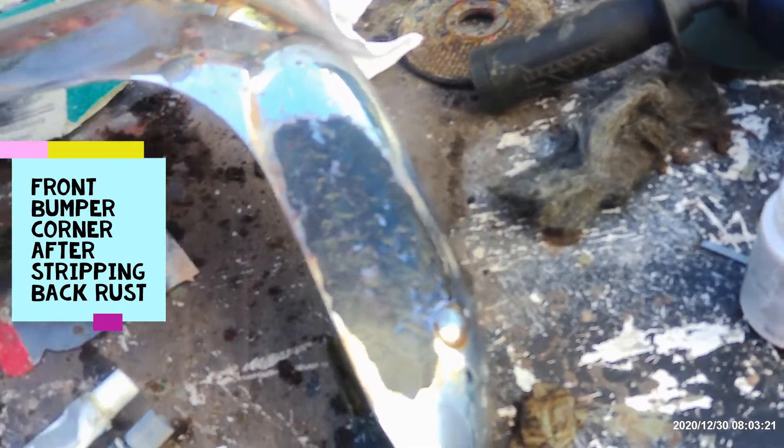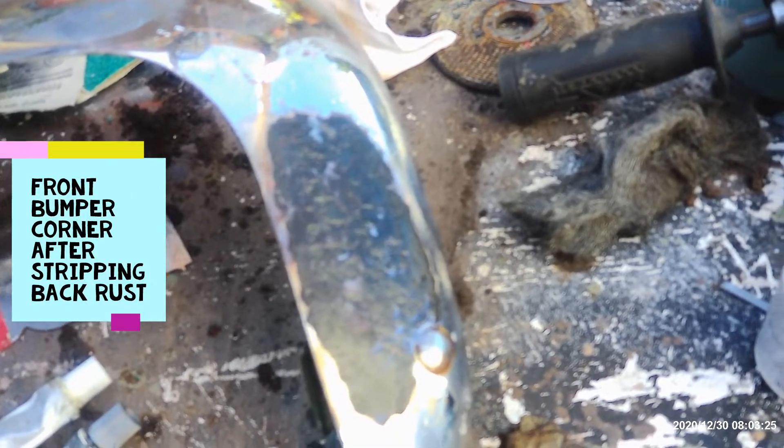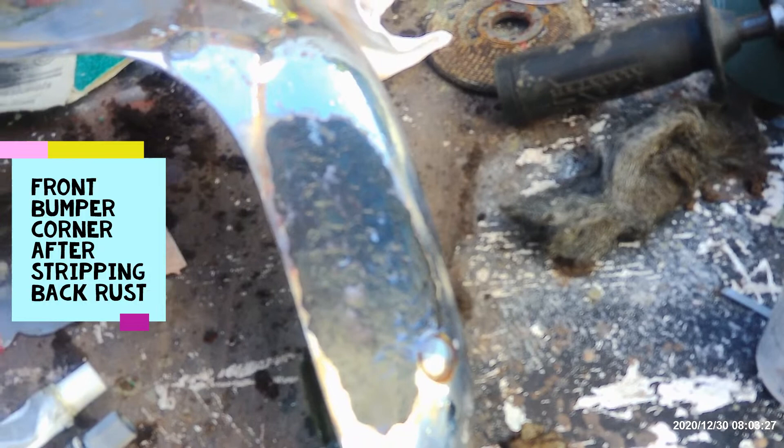So we neutralized it, waiting for the rust remover to dry now, and instead of using filler over it I'm going to try and use some cold weld, just use it like filler, just fill the little holes up and then we will go from there.